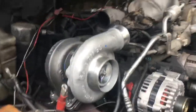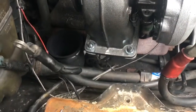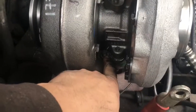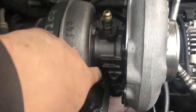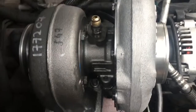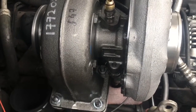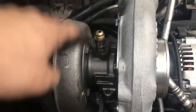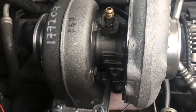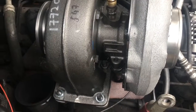It's mostly in as far as the plumbing and bolting is concerned. This nut here was a real pain, so I had to undo the four retainer bolts and separate the turbo again so I could get a wrench in there. Now I just have to fill it up with oil, put the feed line on it, and then we can try to start it and check for leaks.